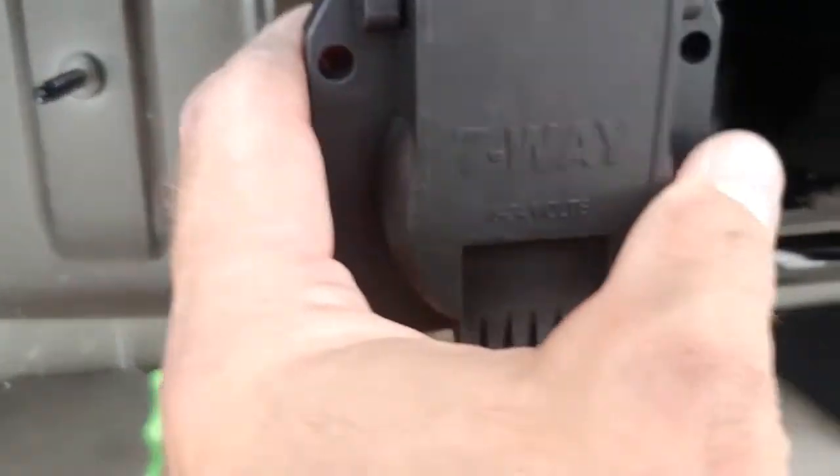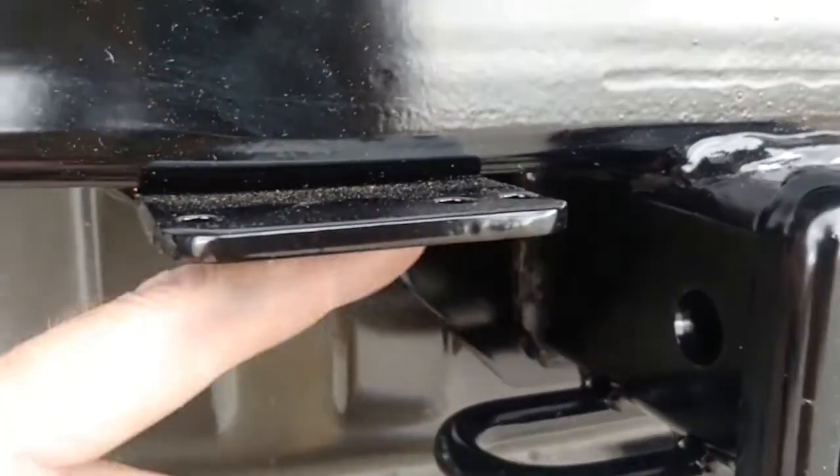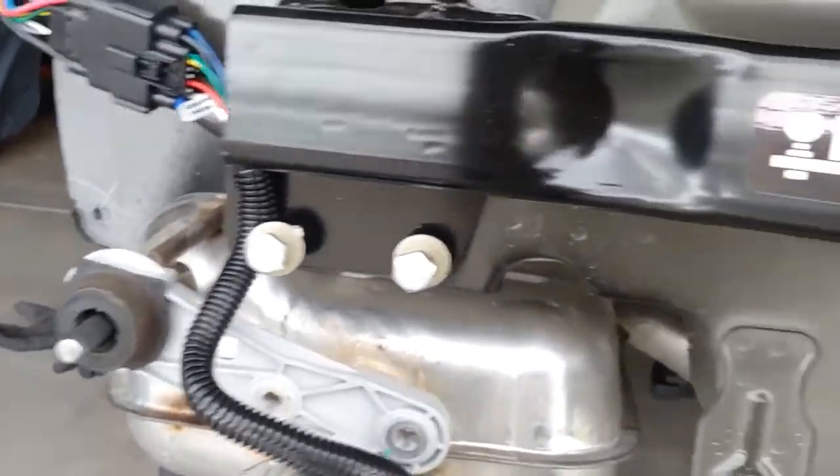Fish the wire through to this — it just plugs into the back of your connector, and the mounting plate over there will mount this to the bottom of that. What you want to do is mount the plate backwards — don't mount it this way. You want to mount it this way so that it recesses more, so you can fit your cover back onto your bumper. Anyway, that will do it — thanks.